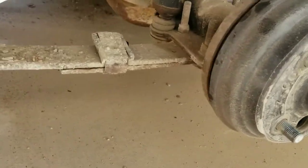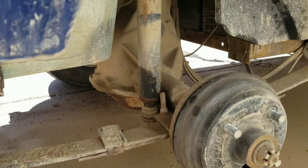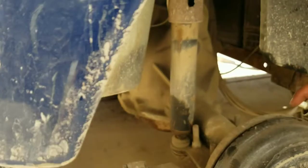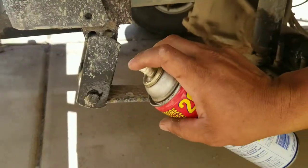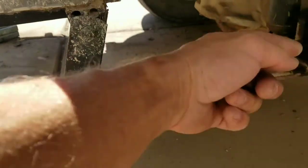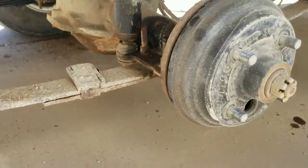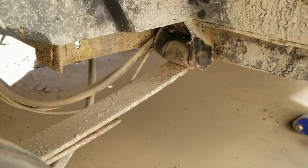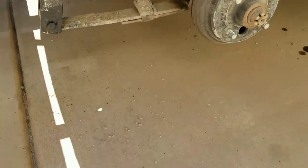The leaf mounts to the bottom of the axle here. This thing's so rusty and bad — these bolts do not come off, so we're going to have to grind off each one. The other side was a failure, so we're just going to come in here and cut these bolts out. We can try to get the U-bolt nuts off; if not, we'll cut from the bottom and pull them out. We're going to cut this guy over here off so the whole leaf will just drop.